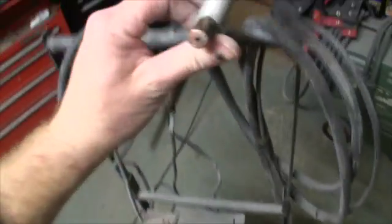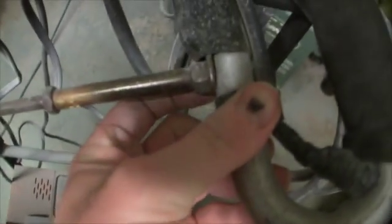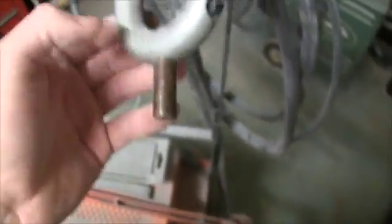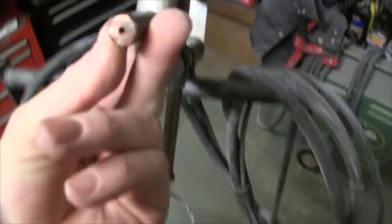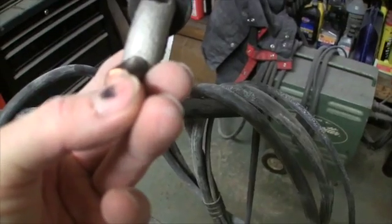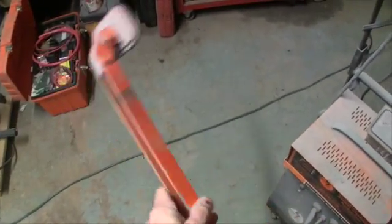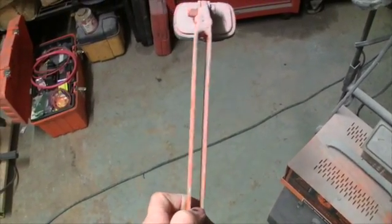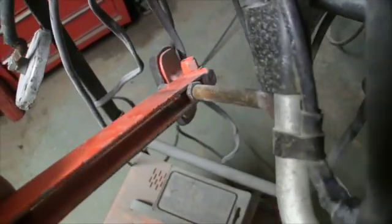On the handle, this is the shrinking tip — it's also hooked to the power. Here's your power lug right here. The handle is aluminum but it will still get warm. This is just a momentary switch. The shrinking tip can also be used with a stud pin — if you have a slide hammer that works with stud pins, you can use that. I mostly use it with a leveler-type handle that I made after watching videos of this machine being used. It's basically two pieces of eighth-inch flat bar spaced apart; after you weld it, you raise up on it and it pulls the pin away from the vehicle.